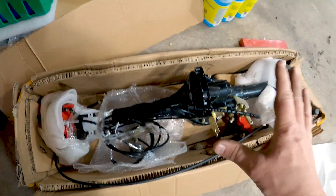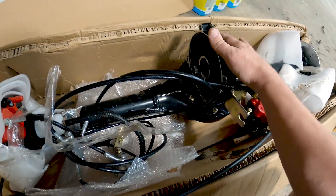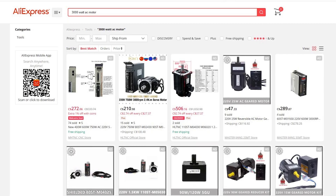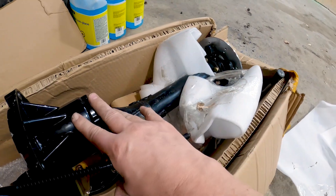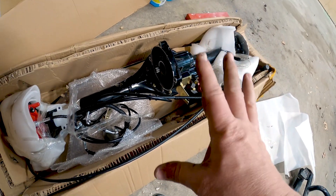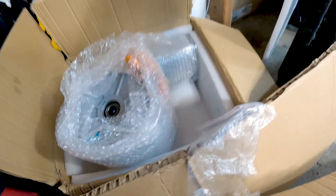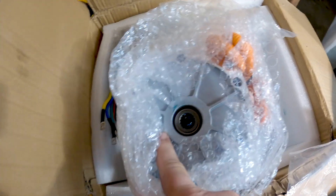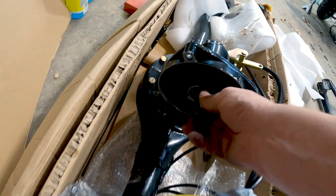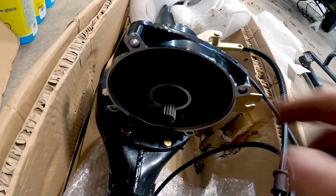The first thing I can show you is our new electric rear end. This comes as a complete kit — I bought it on AliExpress. It has rear axles complete with a differential. What powers the electric UTV conversion is this: a 3,000 watt AC motor. It has regenerative braking, and the input shaft should be splined correctly to go right into this splined differential.